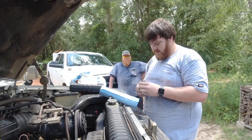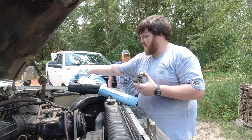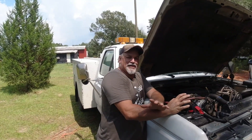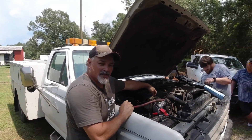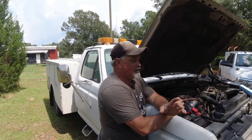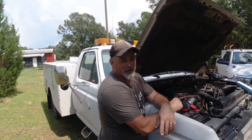You're a real mechanic when you carry a spare engine in your truck. I don't know if this one's any good but we can try it. This one right here is a piece of junk. We moved it about 10 feet further into the shade — feels better with that sun beating down on you. Some of the diagnosing we've done: he's showing 13 volts on his gauge inside, so that's not a problem. We checked the fuel coming out of here and it was fine, so we know the system was primed. Then we took the return line off the fuel injection pump and were not getting any fuel flow out of there. So now we're in the process of swapping out the shutoff solenoid.